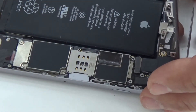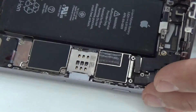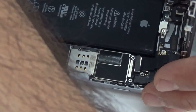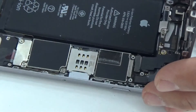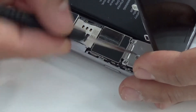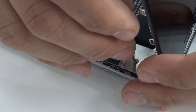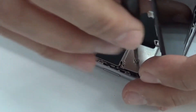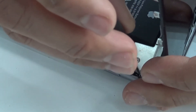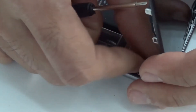We're just going to put the covering plate on, which effectively supports the connectors from coming out. I've got a feeling there's a screw there — no, that's fine. There we go, that's now going in. What we now have to do — it helps to have a magnetic screwdriver, definitely. Now we have to make sure all the screws go in the right place. The rule usually is you put the smaller ones in first, because wherever the small one doesn't go in, you know the long one goes in there.